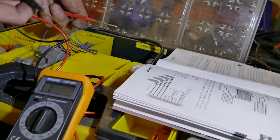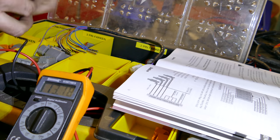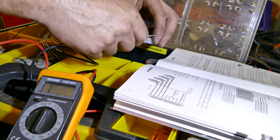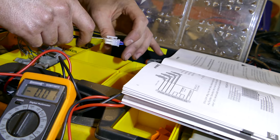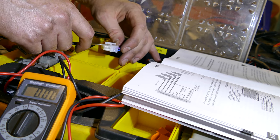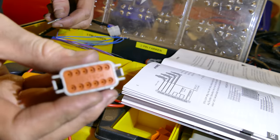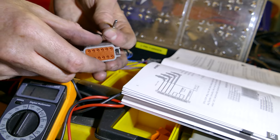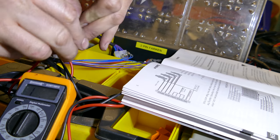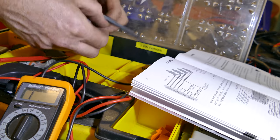The number shown is 1, meaning open circuit. If I close this circuit, it becomes 0. I put one end on that pin and the other end to complete it. That's channel 4. You can see the numbers on the back of the Deutsch connector, so I'll grab pin number 4 and insert it into position number 4. We're good to go.